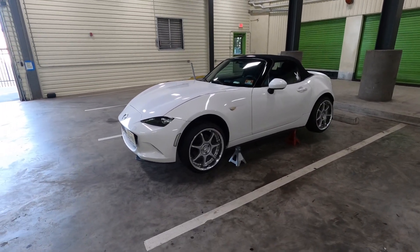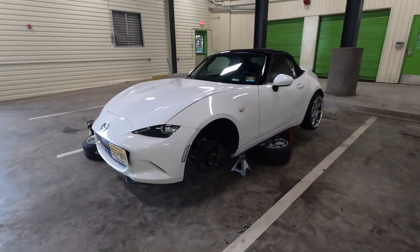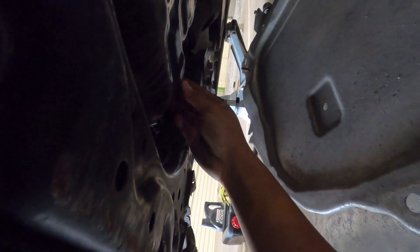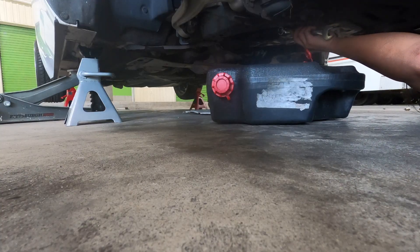Get these front wheels off so we have more room. All right, let's start this oil change — do this oil change real quick. I'm going to take off the under tray; that's a bunch of 12 millimeter bolts. Now this drain bolt — I think it's probably like a 17. I like to use a wrench when loosening this.